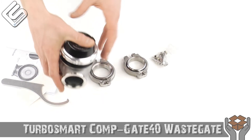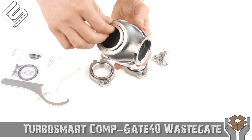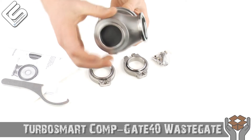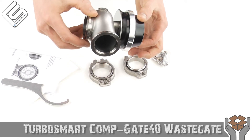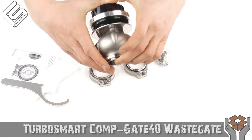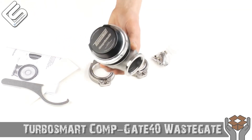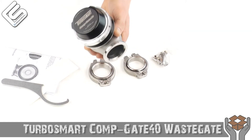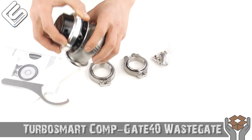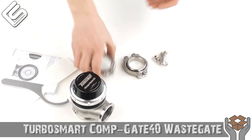A couple other things on the valve: of course you see the giant T logo for TurboSmart. The valve seat comes out but should be left in the valve — make sure you leave that in when you install it. All v-band flanges, which I love, makes it super simple for the install. One of my favorite things is this heat shield. With wastegates, heat is a big issue — you've got a diaphragm up in here that can melt when it gets too hot, rendering the wastegate worthless. TurboSmart has installed this heat shield to keep the heat down where it's supposed to be and leave the diaphragm cool enough to continue working even under extreme conditions.